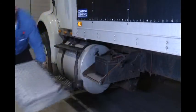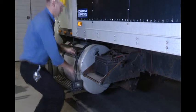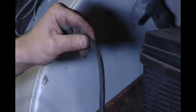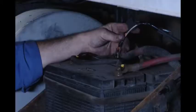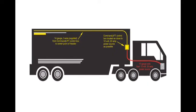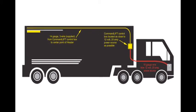You will require the services of a qualified person to connect the Command Lift to the vehicle's battery or other suitable 12-volt, 20-amp power source. Use a two-wire, 10-gauge wire harness to complete the next step of the Command Lift installation process. Make sure the wires are a minimum of 10-gauge and that the harness is long enough to reach comfortably from the converter box to the 12-volt, 20-amp power source you've chosen.